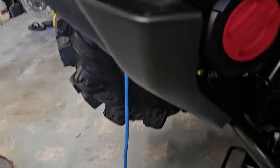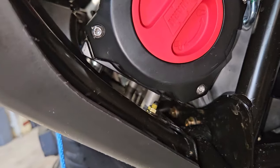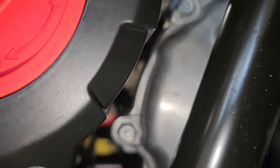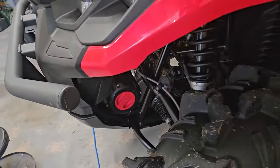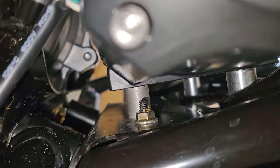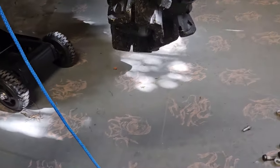The major hardware part of the installation is done. You can see the four posts — the winch is sitting up off the bracket. Is that ideal? Not really; you'd want it flat for maximum strength. But for a 3,500 pound winch I think it's fine. There's enough clearance by the control arms and I'm not touching the diff. I needed just the right spacer to get it up off the frame but not push it into the diff — about a one inch spacer did the trick. I'd say between three quarter and one inch is what you want to make this winch fit by spacing it up off the bumper bracket. If you buy this winch and it doesn't fit, just make a trip to Ace Hardware and you'll figure out what you need.